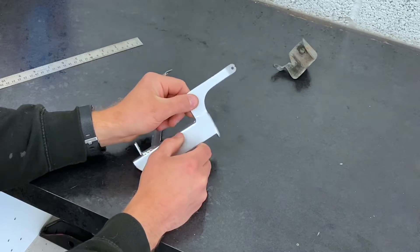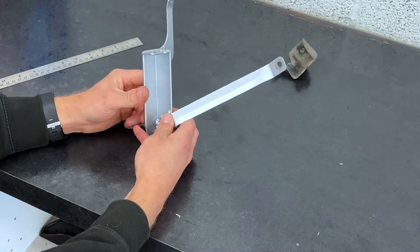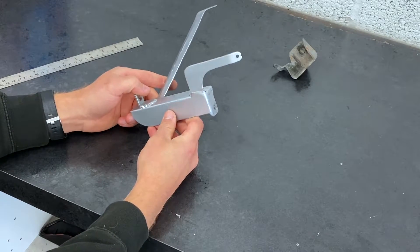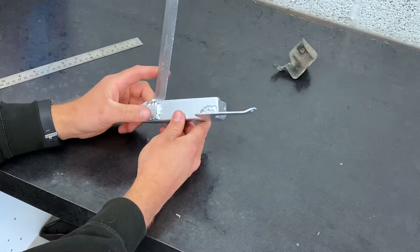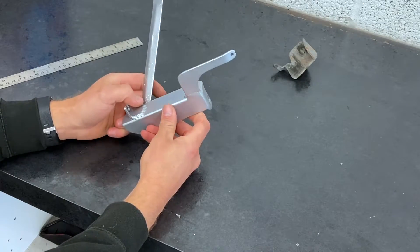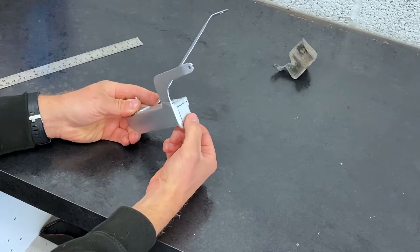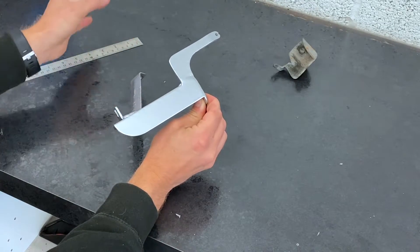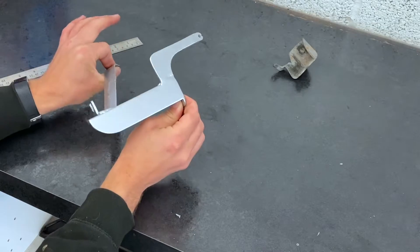Those are the important measurements. Hopefully if you're having a go at making one yourself, you'll be able to work into the depth and specific measurements to make it personal to your car — but this gives you a heads up on the pitfalls to avoid. The fact that it's made out of angle iron makes it nice and strong. It's all MIG welded up and I haven't flushed the welds back to keep them strong. The little stiffener that goes down onto the TVIS finishes the job off nicely. This bracket mounts onto the throttle body and this one mounts onto the TVIS — the throttle body, inlet manifold, TVIS, and engine are all one entity; they move together, so the bracket is not going to shear.